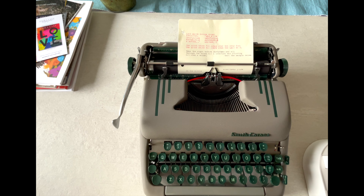Over here you'll see L, 2, 3, 4, 5, 6, and then H — that's your touch control. It determines how hard the type bars are going to strike your paper. For example, where I showed you the type sheet was a little uneven — perhaps if I move this up to a five or six it might imprint a little bit easier. Each person will want that in a different place. We all type differently and have different pressure; my husband has a very heavy hand when he types, whereas I have a very light touch, and that impacts how your typewriter types along with this little adjustment.